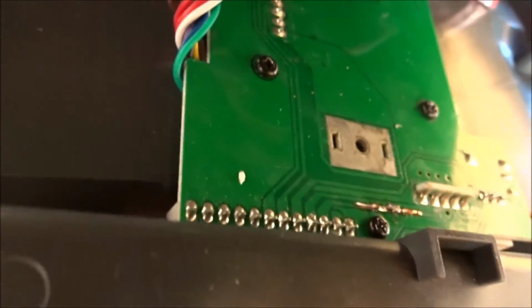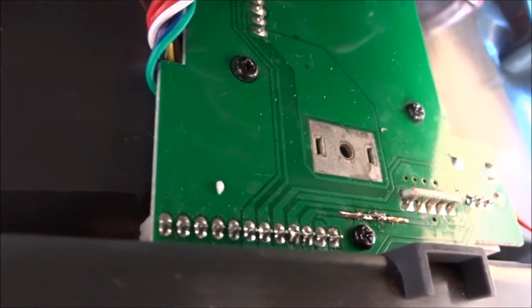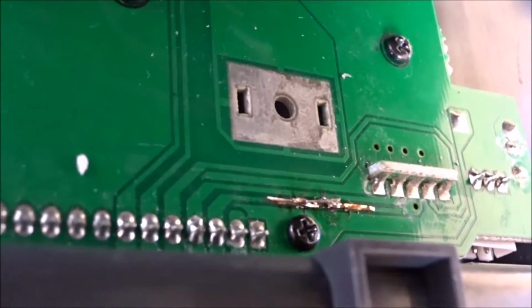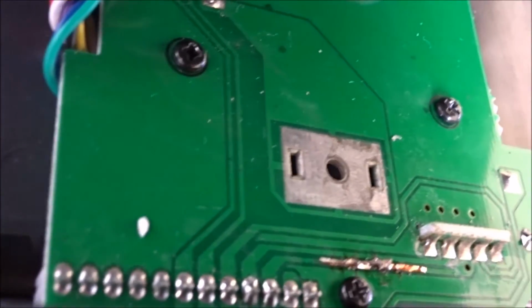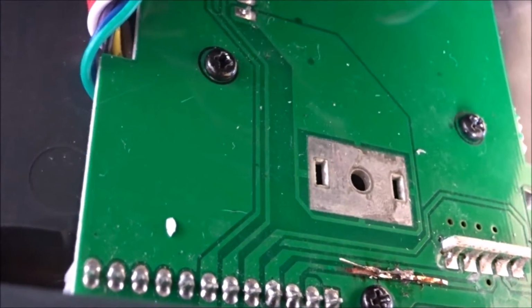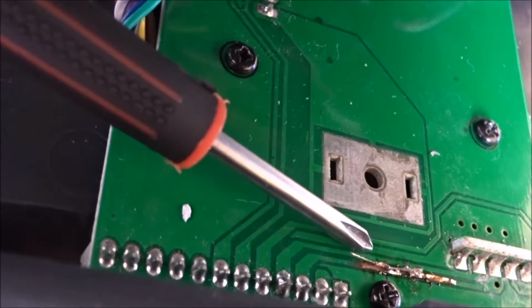Okay guys, I'm back. I think I did figure out what the problem is, and I think it now works, because I turned it on, and it did the whole beep thing, and I saw the screen. Upon closer inspection, after I turned off the camera, I saw this little thing right down in there. There was a piece that seemed to be blown out. Maybe when it short-circuited, it, right there. Let's see if it will focus. I don't know if it will. Okay, that's good enough. But right there, that piece, from right here to right there, it was broken. So I just soldered in a little piece of wire right here.